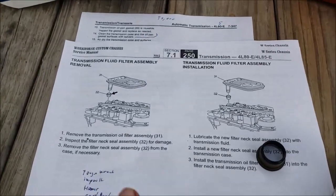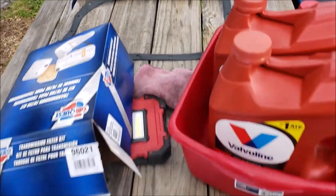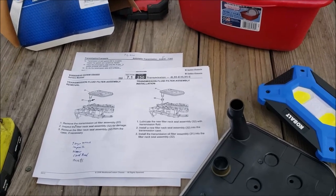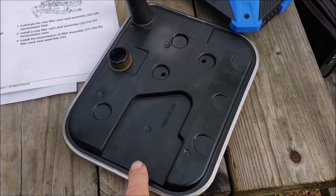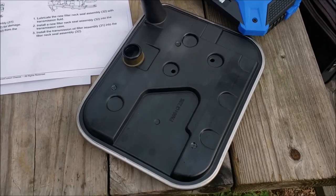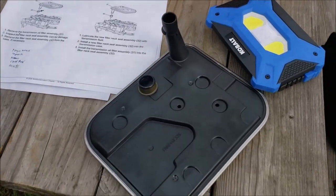So this is what we're going to be doing today. I've got the schematic out, I've got the torque specs, we've already got the parts we need — got a new filter, got the new seal, got the nice new rubber gasket instead of the cheapy cork gasket. We're going to drain the oil and catch it so we know exactly how much to put back in. I also want to open up the filter, because in the past I've taken these apart, opened up the filter and seen metal or debris, and it's a good early warning sign to get it into a transmission shop. Hopefully we won't see that — it's been about 50,000 miles since the last oil change, and the RV has 105,000 miles on it, so it's been 50,000 since the last transmission filter.